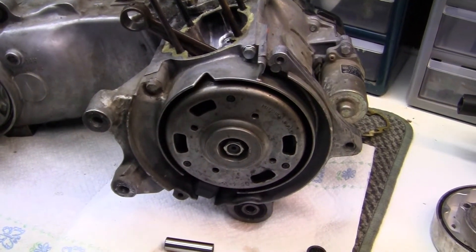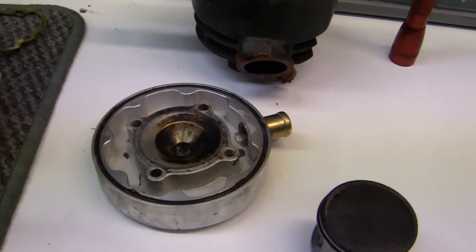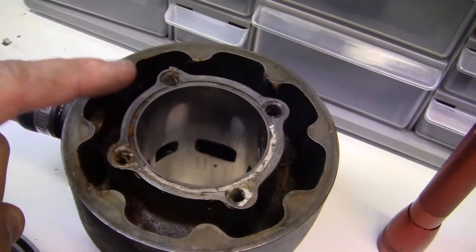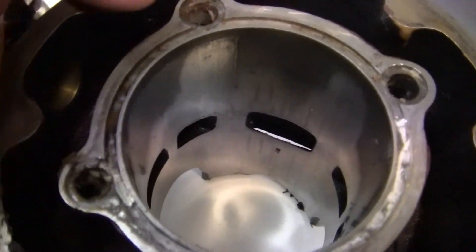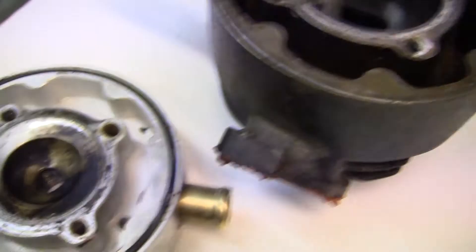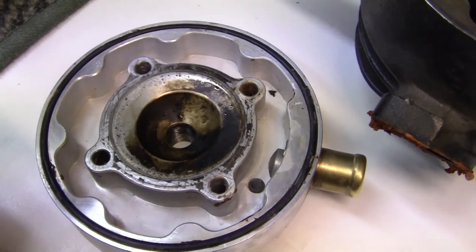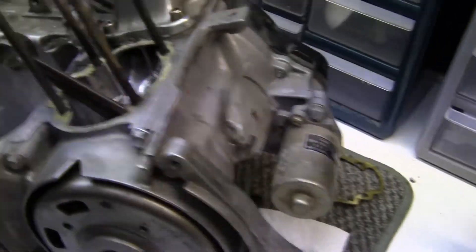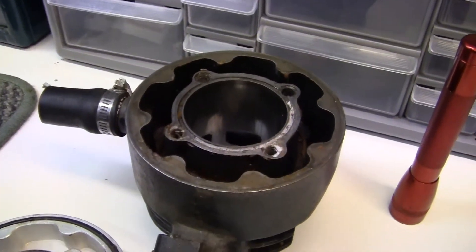Replace the seal one way or the other. I've looked into gasket materials — I can get some Viton O-ring rounds that aren't O-rings but they're just a big sheet of Viton, and I can cut a ring right here for this little squib all the way around. And I've found some copper woven head gasket material that I can buy and cut out a really nice one. That way the head will be off the top here very little and it'll all work out.